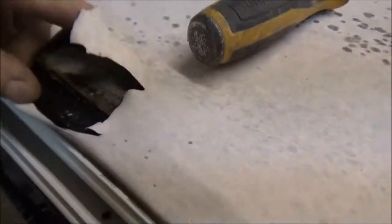Oh, I don't know if you can hear that. Back on it a little bit on the camera. That's rotted right there. We'll see what problems we got under there. Another leak right here in the corner because they don't put good protection on there. Let's just see what they do have in there. So you got this sharp edge from this metal right here, or the roof deck, excuse me, the roof deck, and then all they did was try to put some tape on, and the tape didn't even make it, so it just breached that.